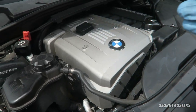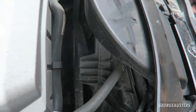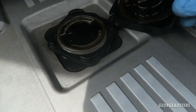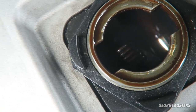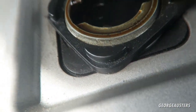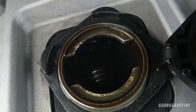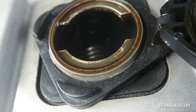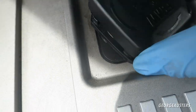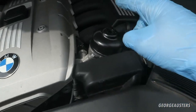The engine has been running for about 10 to 15 minutes so it's properly warm — the radiator fan even kicked in. I'll show you inside the rocker cover now. It's hard to really tell, but it does look a little bit cleaner. I'm guessing we'll need to do quite a few more oil changes to fully clear the sludge buildup, but it definitely looks better after that motor flush. Next we need to remove the oil filter.